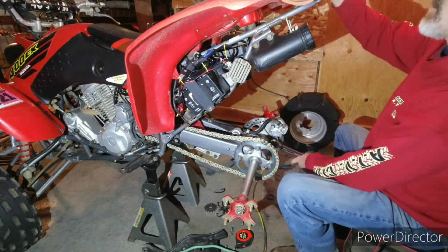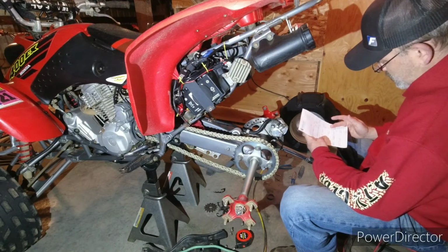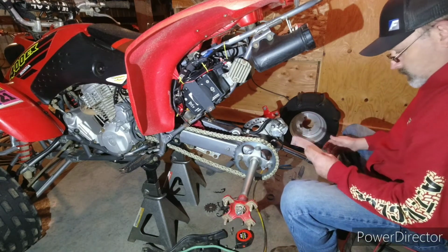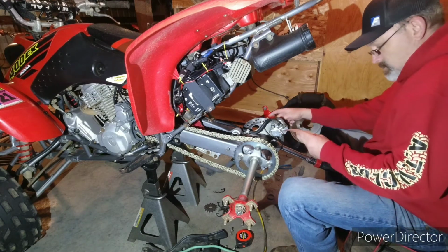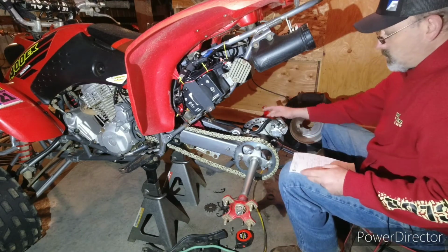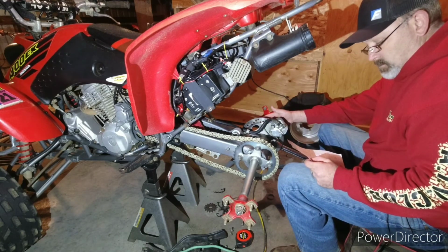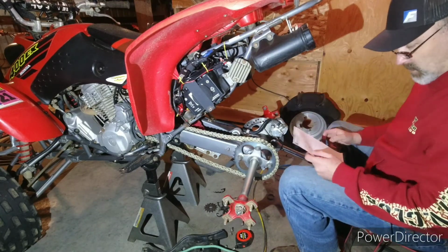And we'll tighten that nut out there. And that is axle hub nut 101. This nut here is 101. I got these torque specs offline. And then the nuts that hold the axle in and keep the pressure on the bearing, it's 65 on the outer one and then 94 on the inner one, the thin one that jams against it.